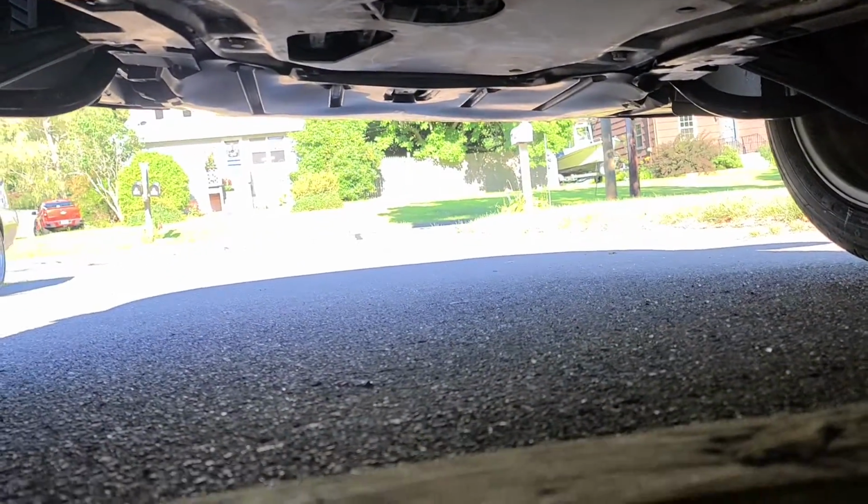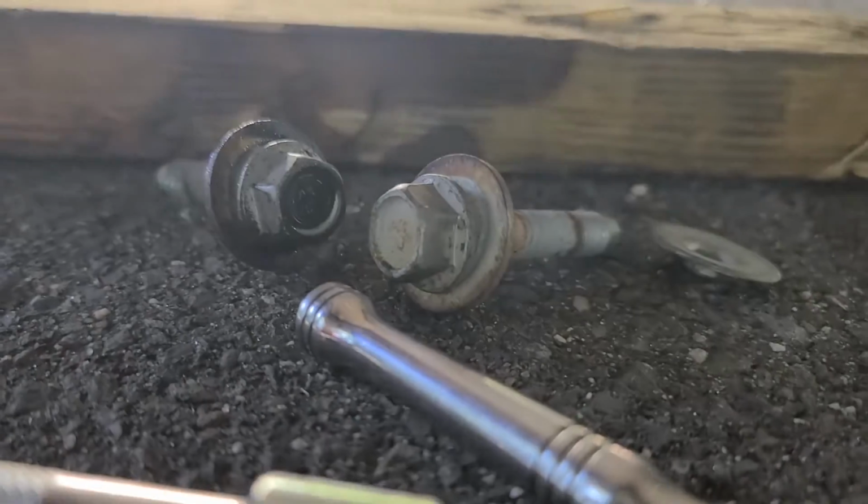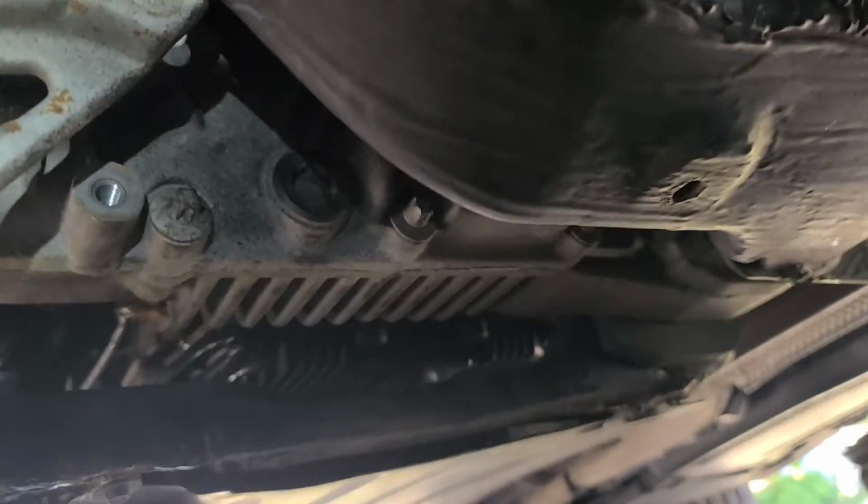But basically there's 6 bolts. Let's see where they are. That's these bolts over here. There's 6 bolts here. These are 16s. And they hold this bracket. There's 1, 2, 3, that's 4, that's 5, and there's 6 back there somewhere. But those come down. Once it's down, you just can't drop it because you need to do something. You need to take some other stuff off as well.